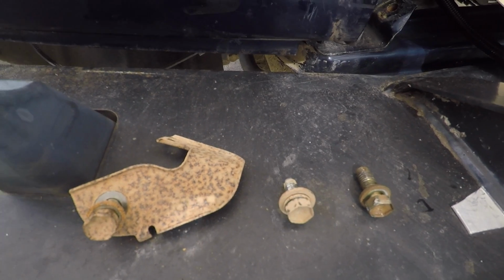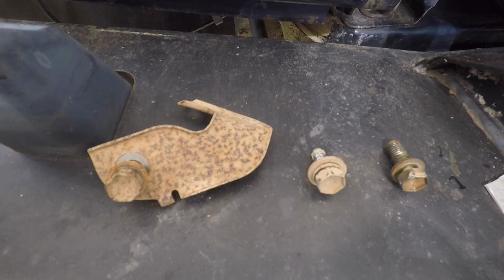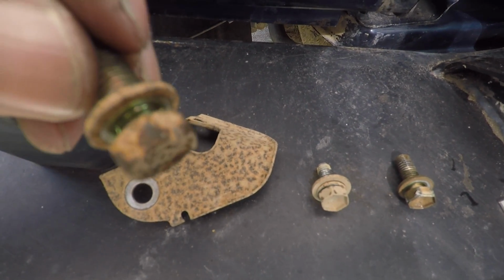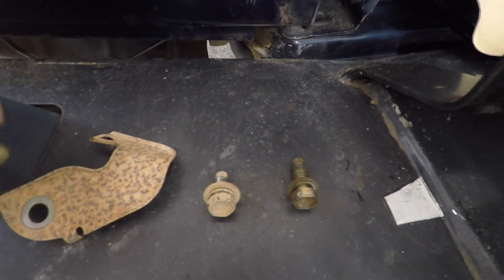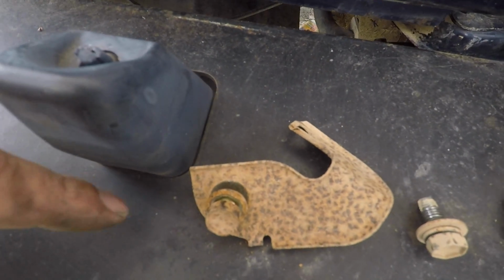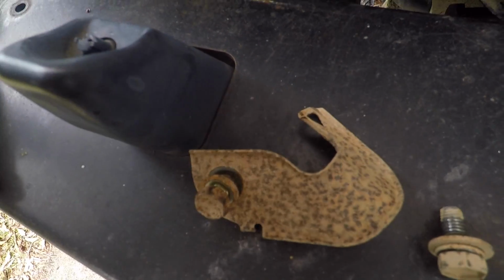Here are the 3 bolts from front to back. This one's directly under the battery tray. You can see the level of corrosion that's on there. It's a zinc plated bolt and the tip of it is really rusty. The other 2 are not too bad, they're just dirty. So what we'll do is get this one cleaned up, painted, and back into service.